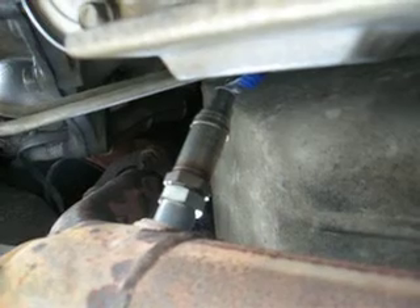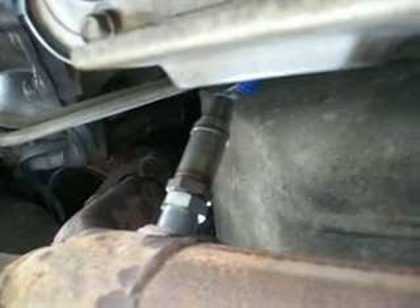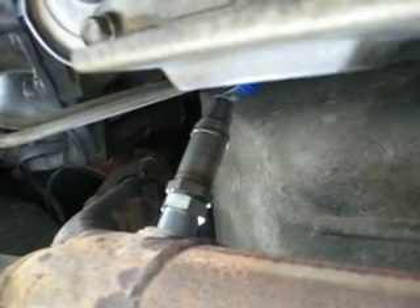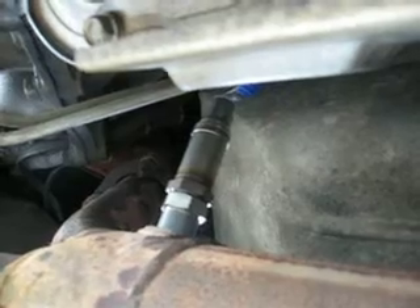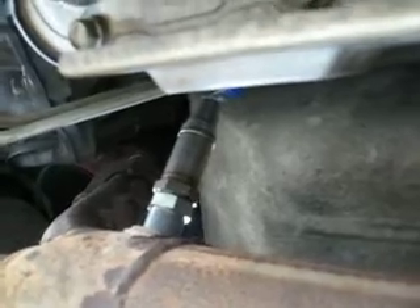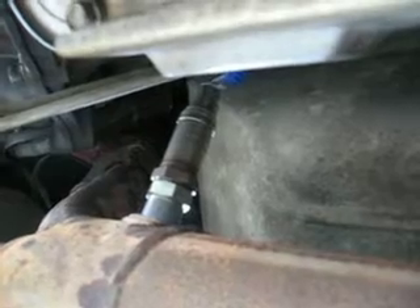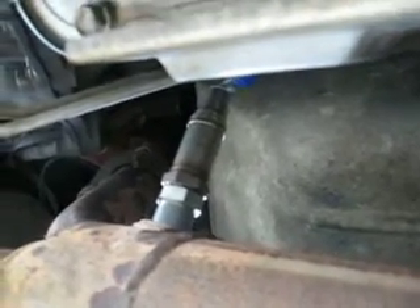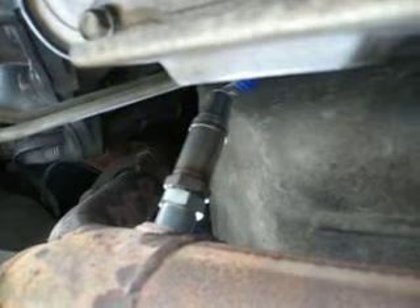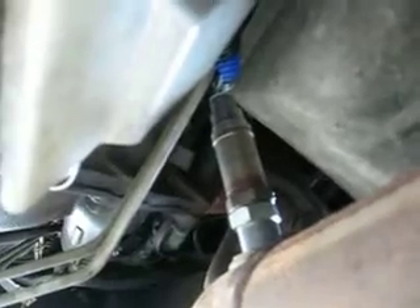Because I'm not going to tie in to the O2 sensor down here underneath the engine. This next segment of the video I'm actually going to take you behind the glove box where my computer is. I'm going to find the signal wire up behind the glove box, and tie into everything behind the glove box and around the computer for my EFIE. But this is what the O2 sensor looks like with the extender in place — I've protected it in a wire wrap.